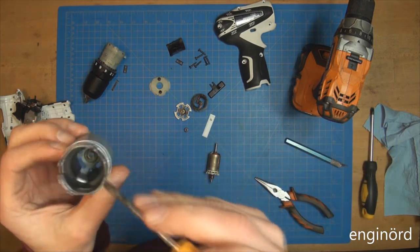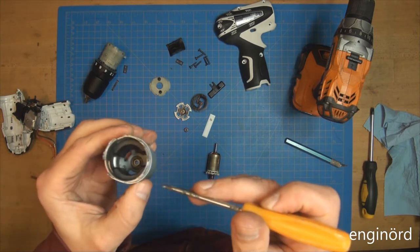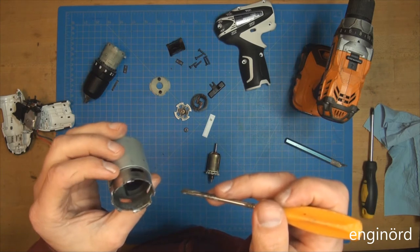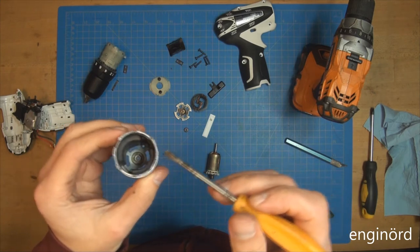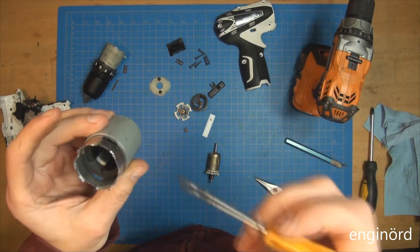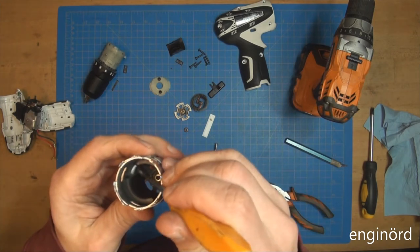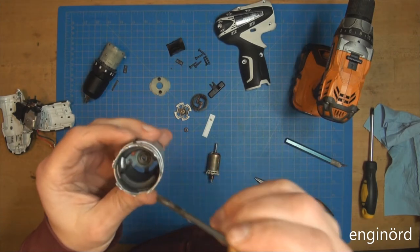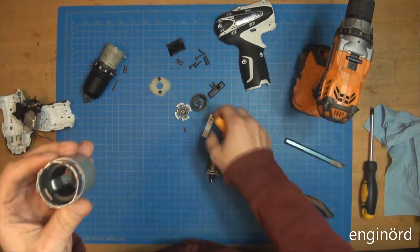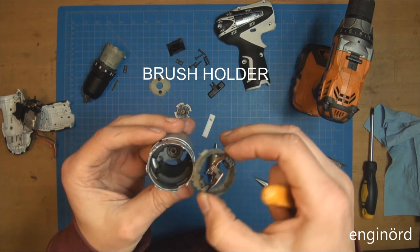And there's two arcuates. That's our official name for these magnets. One of the corners is chipped. That's most likely during the manufacturing. Sometimes they glue these in, sometimes they don't. And you can see that inside the housing here, there's a cold drawn or deep drawn pocket that spaces the magnets relative to each other. They also space the commutator relative to that.